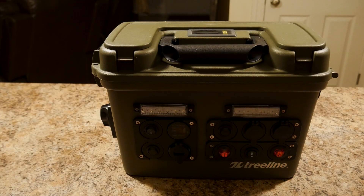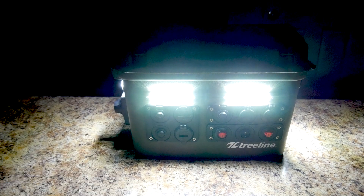Now let's take a look at the lights and the meters at night. The red lights are trailer marker lights that mount internally. I ended up cutting off the ends of the 12-volt sockets and hot-gluing the marker lights in for a perfect fit. A dual-throw switch turns on either the red or white lights.